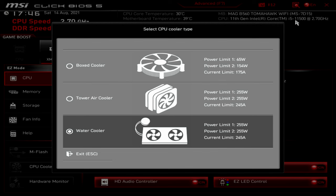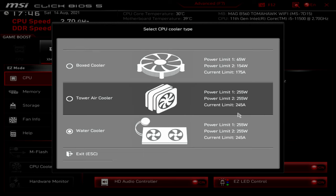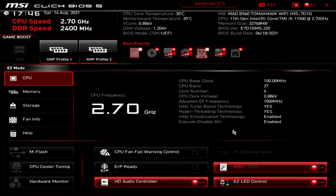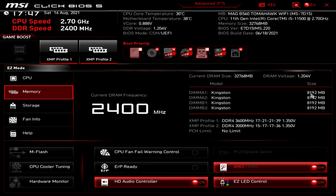After the BIOS update, the computer reboots and we're back in the BIOS. A new option appears asking us to adjust power limits based on the type of cooler installed. We've got the water cooler selected, which is great — the CPU will have higher power limits and should give more performance. Select water cooler and confirm. Next, check the memory speed under the memory tab — we have 32GB installed but it's only running at 2400 MHz rather than 3600 MHz. Looking at XMP profiles, XMP profile 1 is 3600 MHz — click on XMP profile 1.